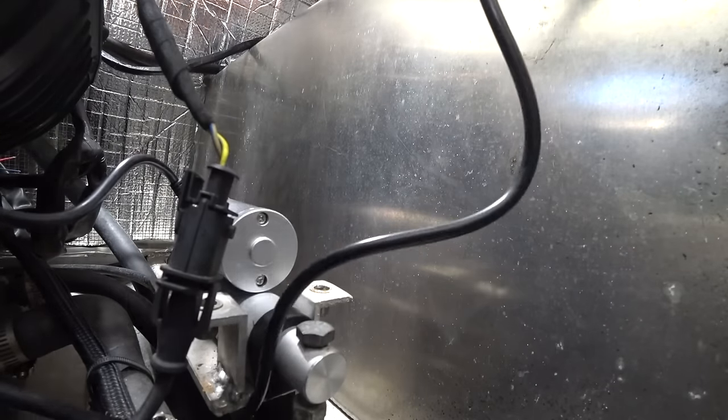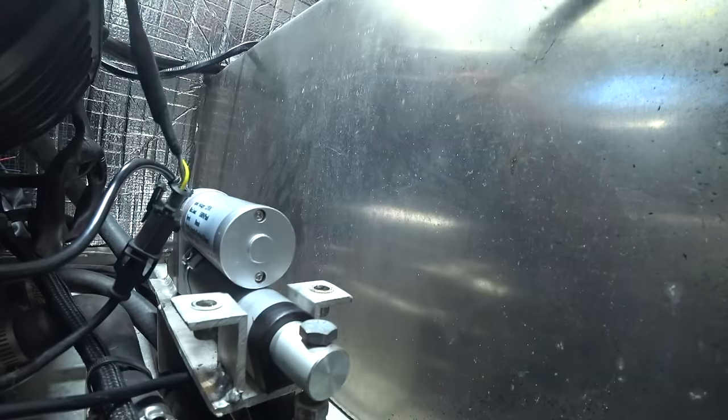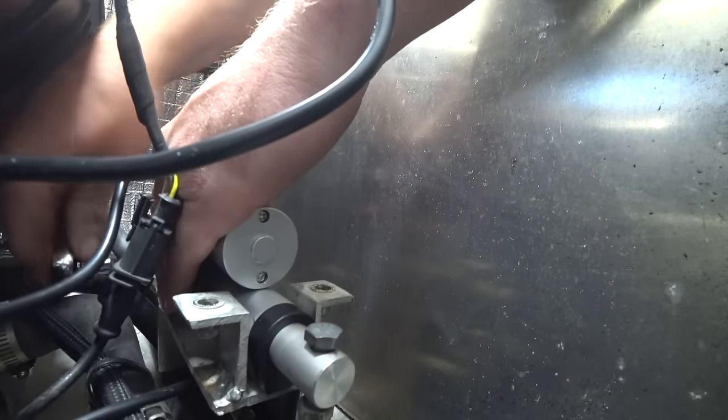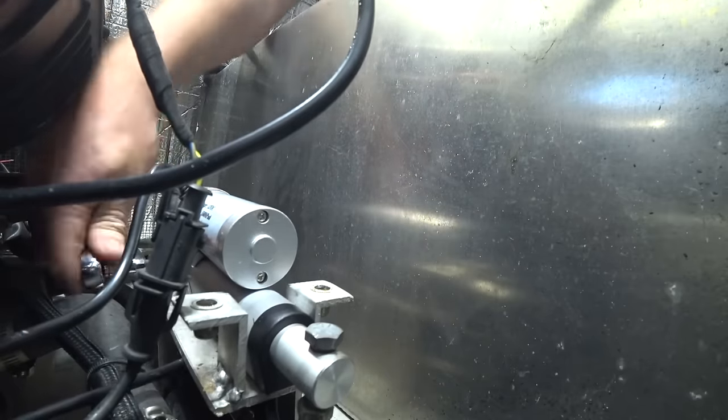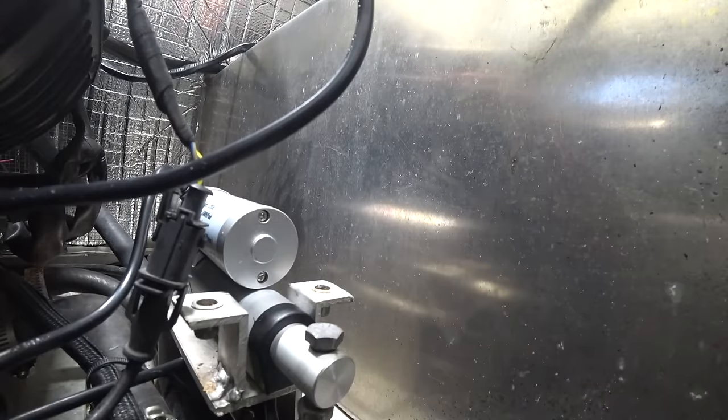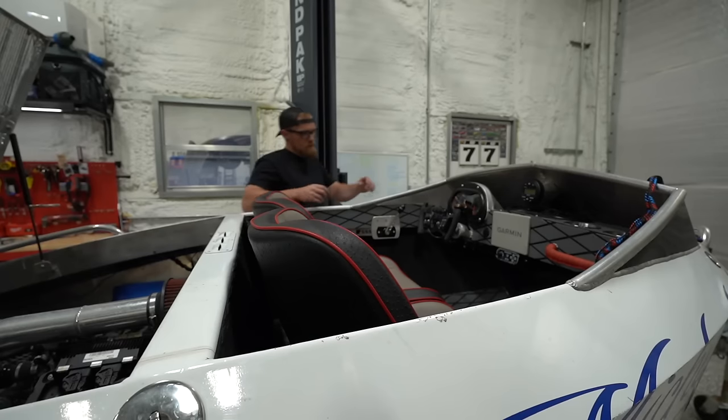You know, we've got the wiring there, the button's all wired, that's all the annoying stuff. Just replacing the actuator is not too bad, but this bracket was just a little bit off where the holes were, so it was definitely a struggle trying to get all the holes lined up. I had to play around with extending and retracting the actuator a little bit to get everything to line up. But once we got it there, it was pretty easy to just bolt it together, hook the wiring up, and test it out. All right, moment of truth time.